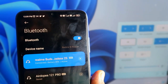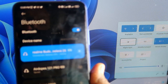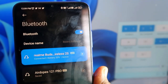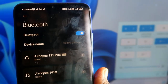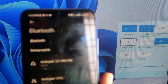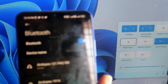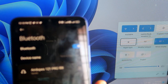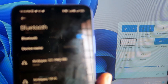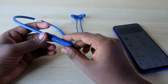As you can see, the Realme Buds Wireless 2S is now connected to the smartphone and disconnected from the PC. If I triple-tap the multi-function button again, it disconnects from the smartphone and reconnects to the PC. This is the switch-over device function — it lets you switch the connection between two devices. To use it, first pair the earphone individually on two different devices, then use the function to switch freely.